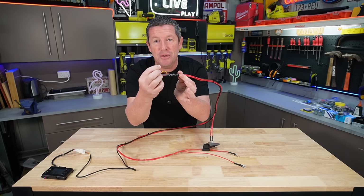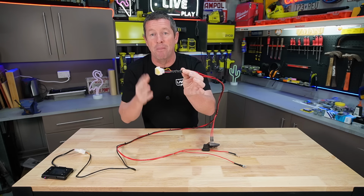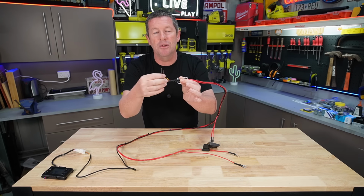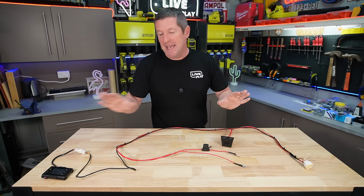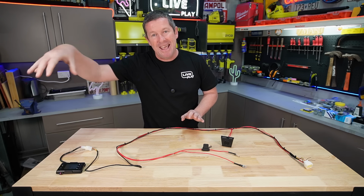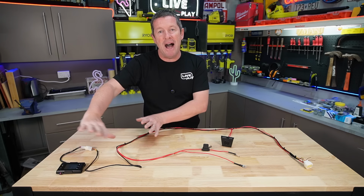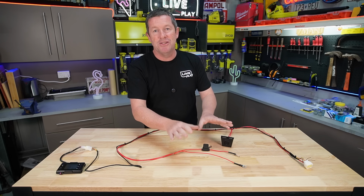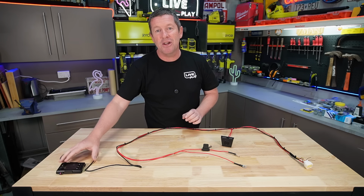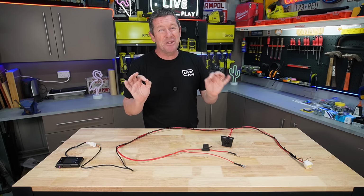Now, the one thing I do need to do when we get back inside the van is actually connect up the loom that comes up from the diesel pump, noting I had to snip that off so I could get it through the floor area in between all the other looms. And then lastly, the final thing I've done is, because my display panel is going to be mounted over on the side in front of our battery management system, which is on the opposite side of the batteries, it's going to follow the same path as our main power loom that goes to the batteries. So I've simply connected it all up with some zip ties, keep it all nice and tidy. It can run off to its location. We can plug that in once we get inside the van, and it keeps it all nice and tidy.